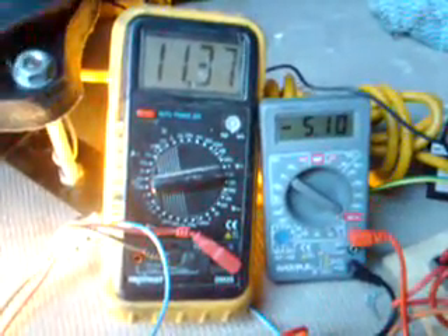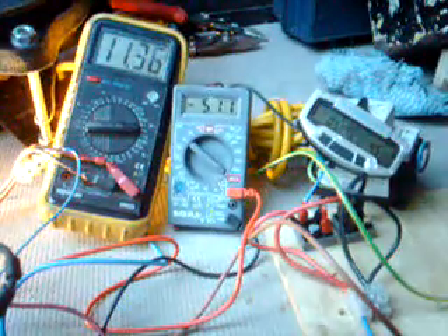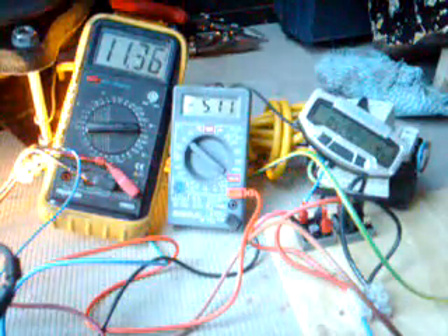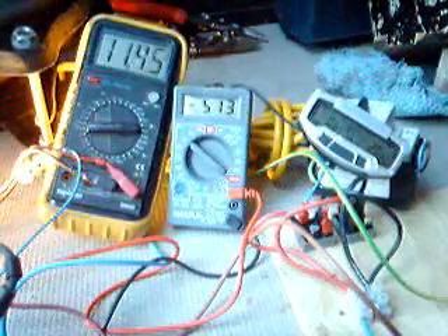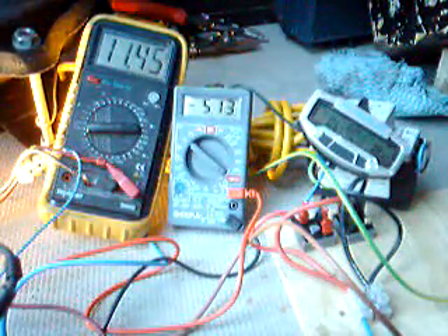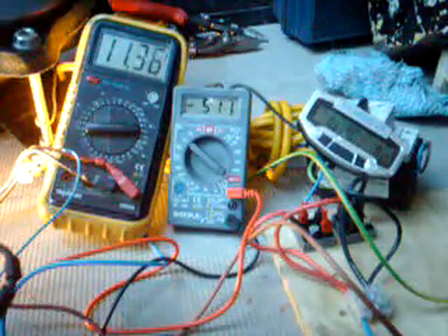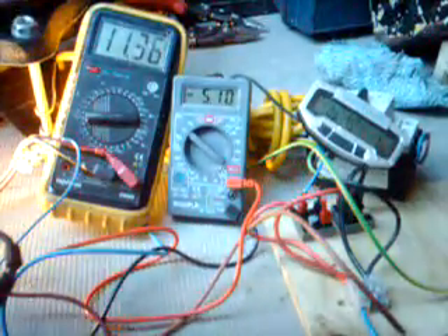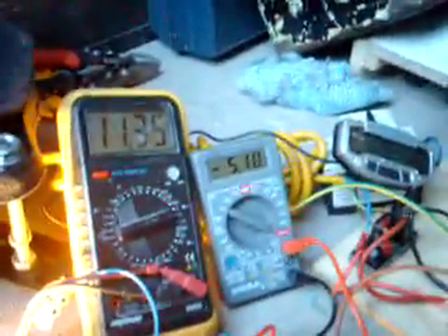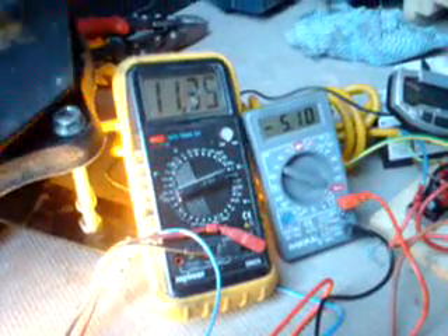It's obviously getting a whiz for maybe 30 seconds - let's see what happens, let's see how much more of a charge we can get into this battery, seeing it's sitting at 11.36 volts. My lights are getting brighter, the motor's going to run faster, so that's obviously dumped my volts back into it, only they come straight back down again. Under a longer period of time we'd probably put charge back in, but as it's drawing 5.1 amps, I don't know if that means I'm putting 5.1 plus amps back in for it to be charging up a wee bit.